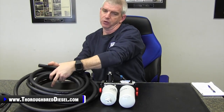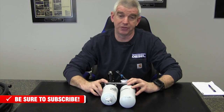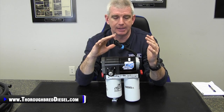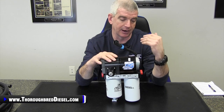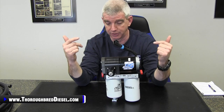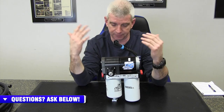You're still getting the same 300 PSI-rated half-inch fuel line, ready to go in the box — everything you need, so you won't have to go to the store for more fuel line. On the new 5G they've also changed the fitting sizes so you can use AN fittings on this pump. If you don't want to use the quick-connect fittings that come in the kit and prefer to do it all in AN fittings, you're good to go on thread sizes. A lot of guys like that for a cleaner install.